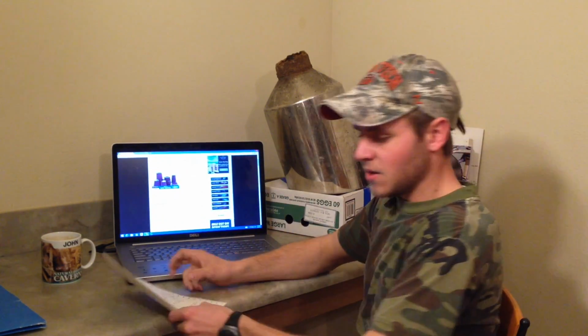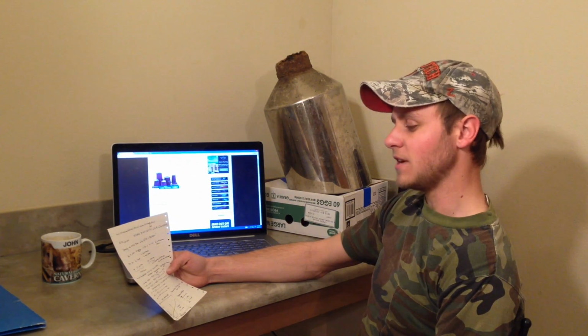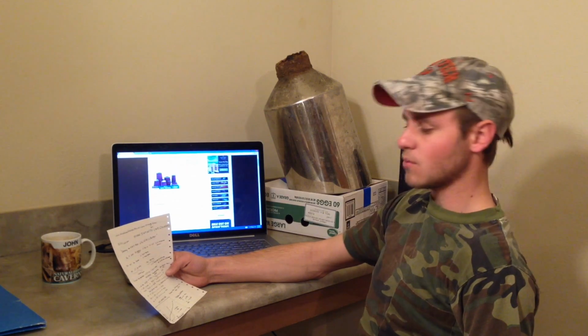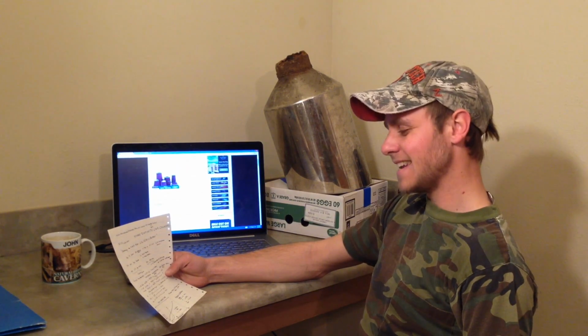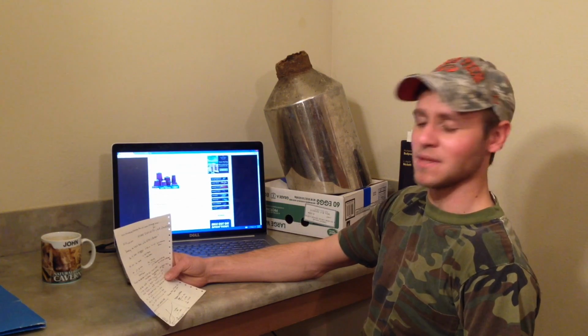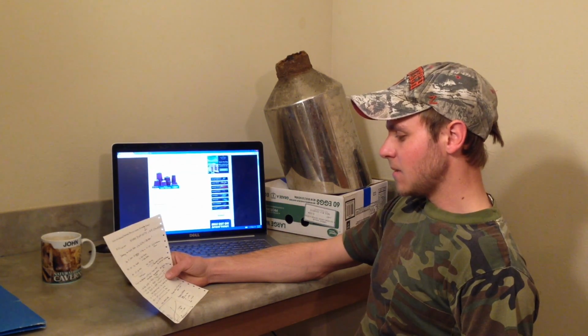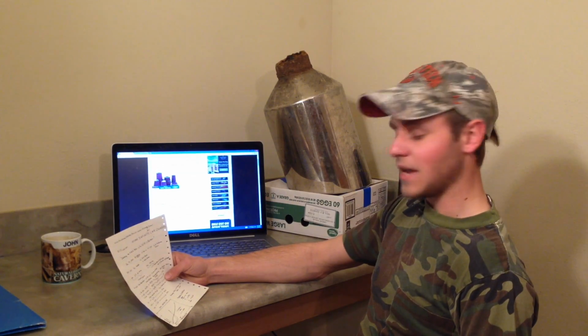But what they ended up finding, best one for filtration was the AC Delco, which was their factory paper style, and it filtered out 99.93% of contaminants. Next up was the AFE, same brand as the air filter I have, which filtered out 99.23%. And the worst was K&N with 96.8%, kind of pathetic. Now for reference, about 0.04 grams of crud got through the AC Delco paper filter, whereas 1.8 grams went through the AFE, and a miraculous 7 grams of garbage came through the K&N air filter.